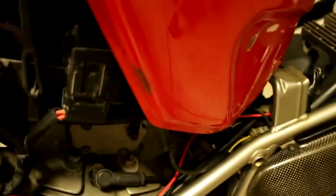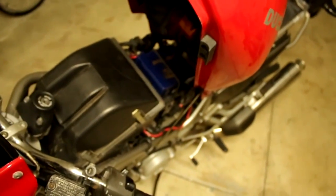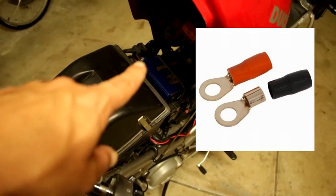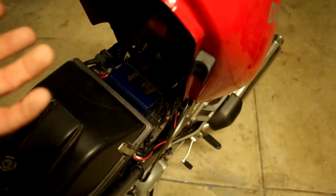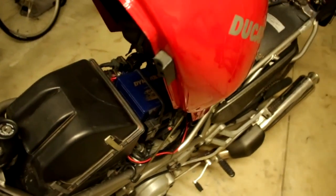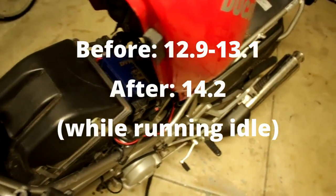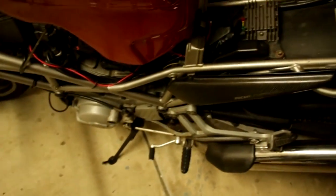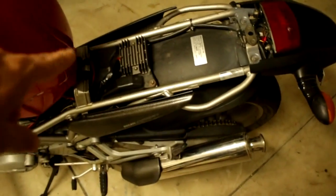I've lifted up the tank so you can have a look. There are two additional wires — I used red and black — decent thicker gauge wire, and I've run them straight from those red wires coming from the regulator, routed up away from the cylinders, nice and high underneath the airbox, and connected them to the positive terminal at the battery. Not the neatest finish yet — I want to get proper round terminals from Jaycar — but that's all I've had to do. That was enough to bring the voltage from around 12.9–13.1 all the way up to 14 volts.